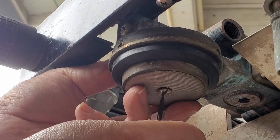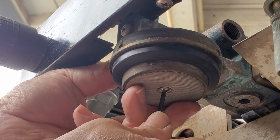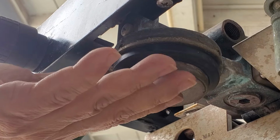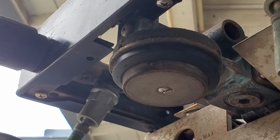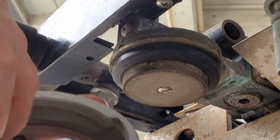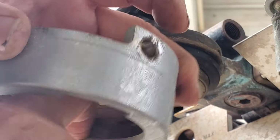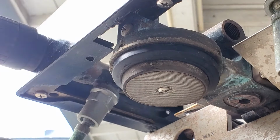Okay, and you just need to screw in the screw hand tight. You don't need to crank it down because you want to remove this every day or every other day or once a week at least. Okay, and then I'm gonna put back the cowling. A lot of times clean out this cowling. Make sure you get all the crud out because it interferes with your portafilter.